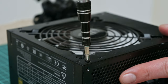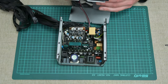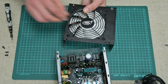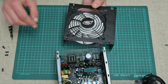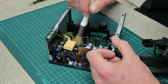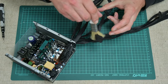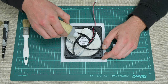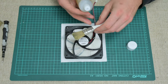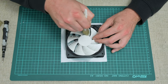Next is the power supply. I open the power supply to take a look from the inside and to clean it. The thing I was worried about is the light smell of mold or moisture, which means the computer was placed somewhere where the humidity was higher. From the inside, except for dust, I found that the smell is coming from the cooling fan blades. Luckily, we have no problem with the circuits or capacitors — the power supply is still in good shape.